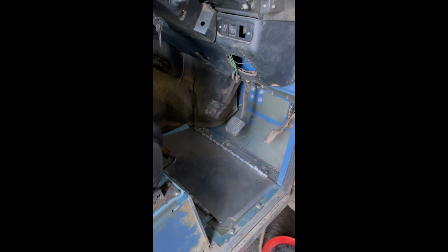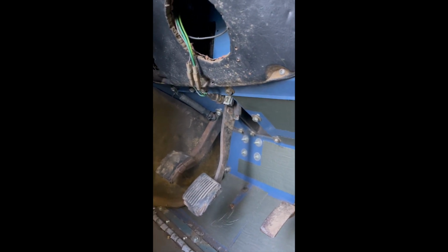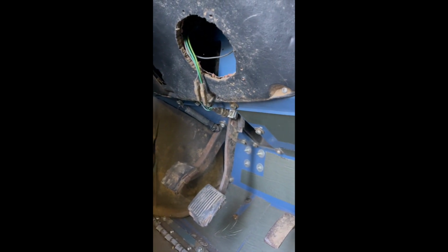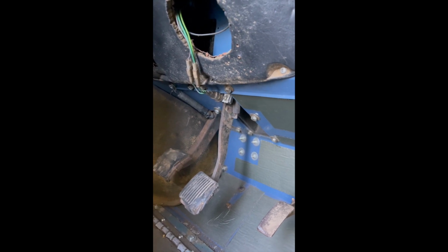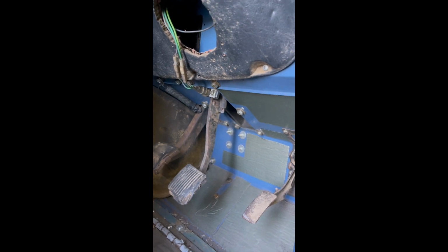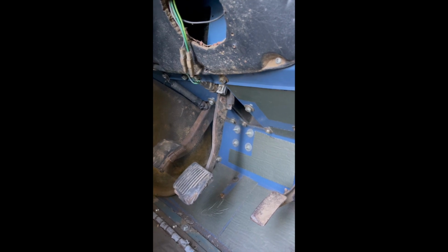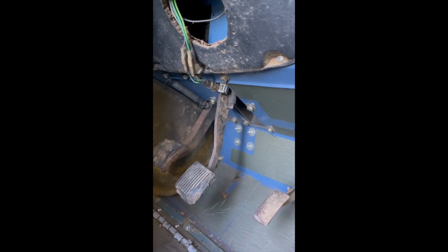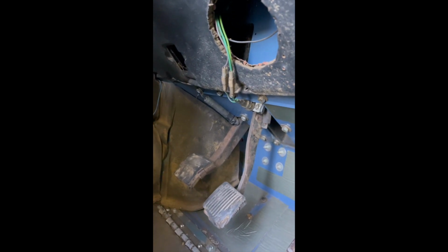The only thing holding me back with the pedal lock was the brake light switch. As I said before, I had to mount it on a little bracket down here. I thought it's because I've gone from early 90 brake servo to 300, but a 300 has the pedal switch actually in the unit. Mine hasn't got it. It hasn't got the hole, hasn't got anything. So having a little look, it looks like I was sold a TDCI one, a very late one, as opposed to an early 300 that I ordered. So there's no hole for it, hence why I couldn't work out where the switch went.